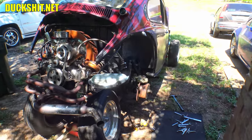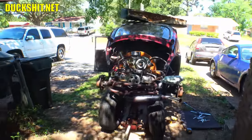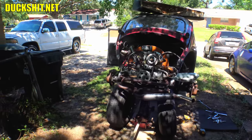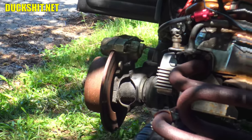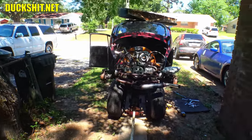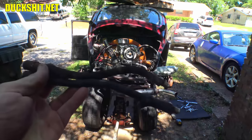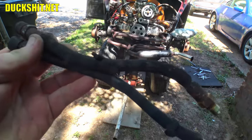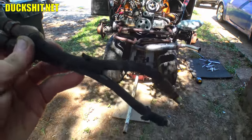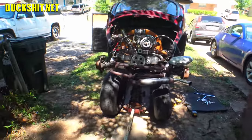All the brake lines on this car had been replaced — solid lines, rubber lines, even the calipers — so I assumed nothing could be wrong. I figured maybe dirt, so I released the bleeder valve on one side and that side began to spin, but the other side didn't relieve pressure. I looked at the rubber lines underneath and found nasty, crusty ones — the only ones they hadn't replaced. The rubber was blown out, fluid got between the rubber and braided line, making them puffy then caved in. New lines are installed and bled.